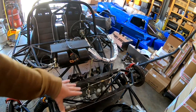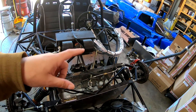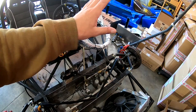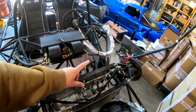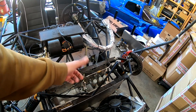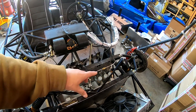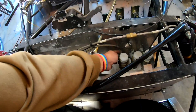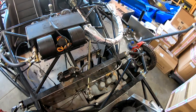I was never really happy with these master cylinders before the fire — this was sort of a get-around-to-it job. Now that the brake system is completely empty and basically needs to be redone anyway, this is as good an opportunity as it gets to replace those. What I needed to do was figure out how big our master cylinders were so I could order replacements. I think I'm going to get either a Tilton 75 or 76 series — the throw is nearly the same, it's less than a quarter inch shorter, the bore sizes are the same or available in the same sizes, the bolt pattern where it bolts onto the firewall is the same, and the push rod length is the same.